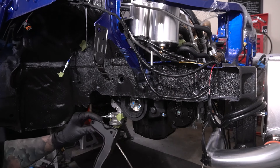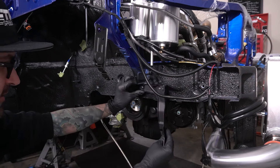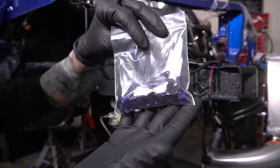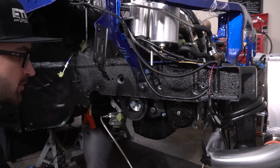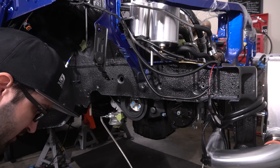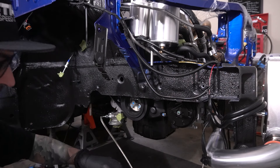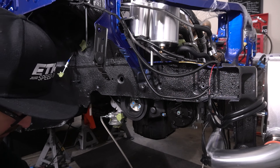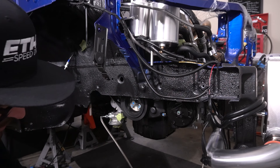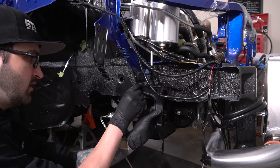First things first, we got to mount the brackets to the oil cooler. Our freshly powder coated bracket will go right here, and then the other one mounts kind of this way. We have some brand new titanium hardware in our custom blurple color. I ordered bolts, lock washers, and washers to match the OEM setup. I'm doing just a dab of anti-seize to help protect the threads from galling — not really worried about seizing up, just enough lubrication on the way in.